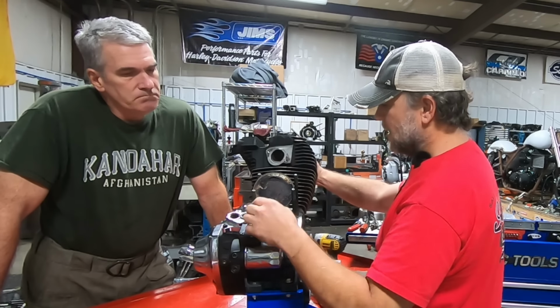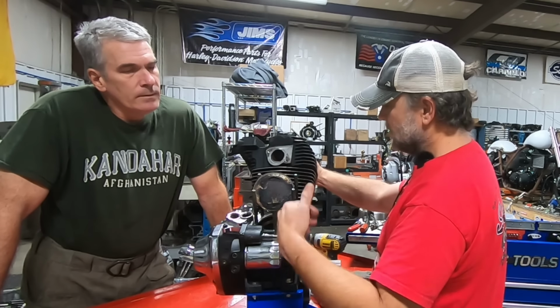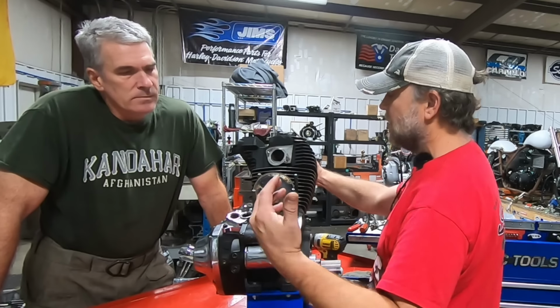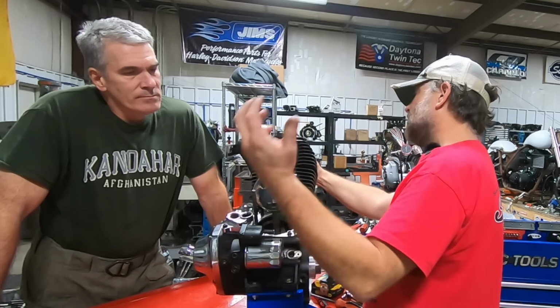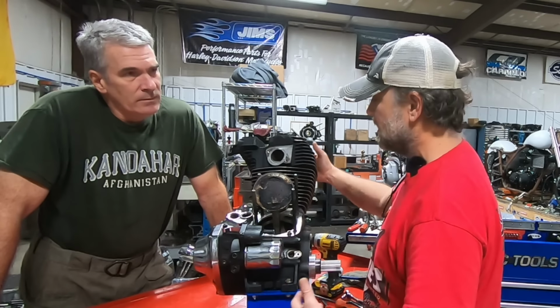started some blow-by, and then when you get the blow-by, you get the elevated crank pressure, and then you start getting oil migration on top of the piston, the carbon buildup, the detonation started, he's putting in an octane booster to try to stop the detonation and all that.